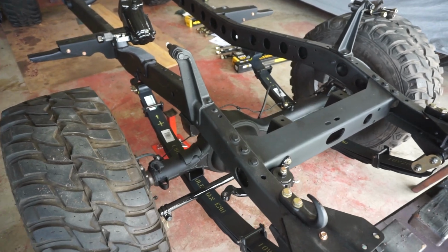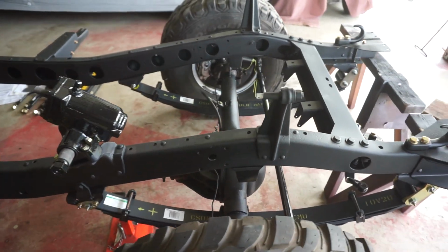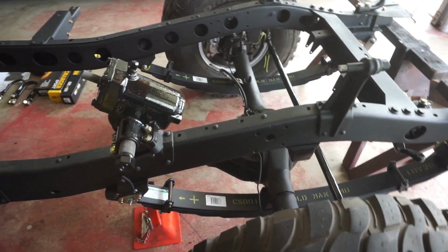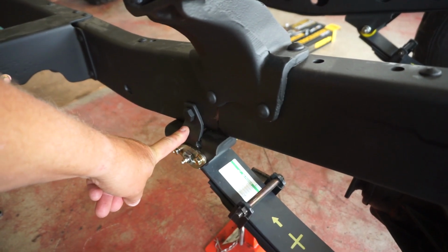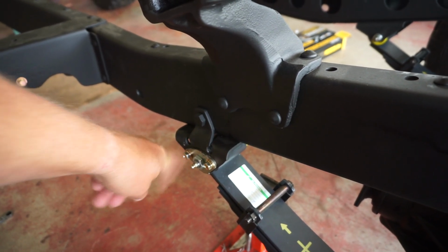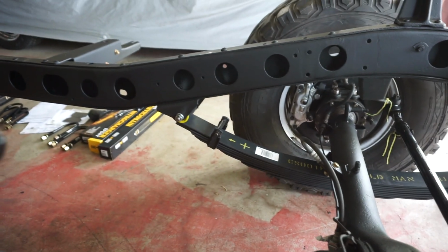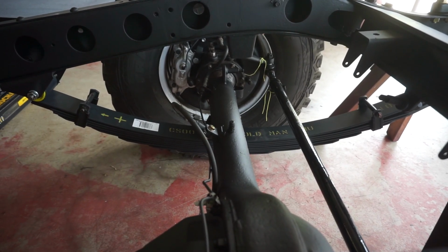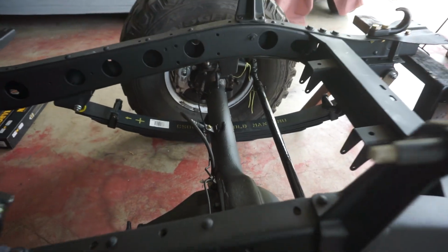Had a beer last night, had a good sleep, done giving myself an uppercut for being an idiot, and I've got the suspension around the right way now. Plus sign with an arrow pointing towards the fixed end of the suspension, just like it's supposed to be on both sides. Next step now, I'll throw the U-bolts on to lock this diff down, put some Shockies in, and then we'll move on to the back side.